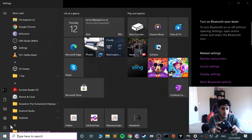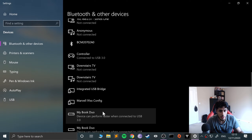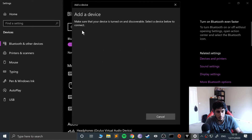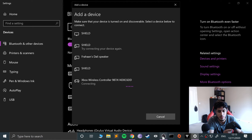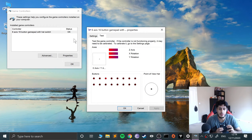To make sure this is working, go to 'Set up USB game controllers' and it's not appearing. I think I know what may have happened — I'm going to remove the device and disconnect the USB just in case. Go to add Bluetooth again, re-pair Bluetooth. I think I connected to the wrong device. There we go — type in 'game', set up USB game controllers, and there we go, it has now appeared. If you get that issue, just remove it and then re-add it.